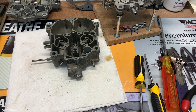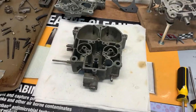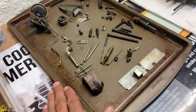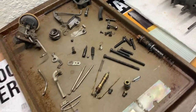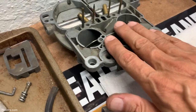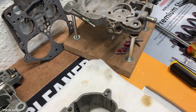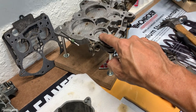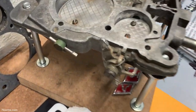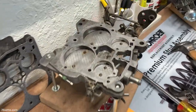I'm going to have to edit this video — we're 26 minutes in but I wanted to get as much detail as possible. All the innards are laid out, I know where they go. We have the gaskets — one of them may be reusable. All of these parts are going to get a good bath. Before I go I'm going to remove the primary throttle shaft so I can install new bushings — it's always a good idea — and of course we want to take everything apart so we can clean it to perfection.